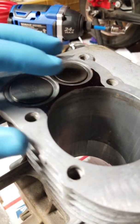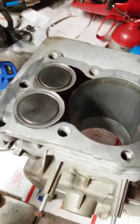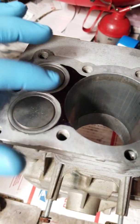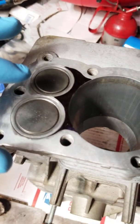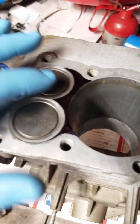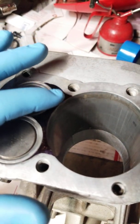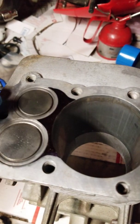What I do is lay a head gasket on top here and basically trace out with a Sharpie, and this is what I'm gonna be knocking down. I shave down into the bore because that is just a straight shelf, straight on top of the piston.